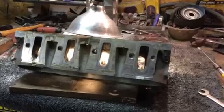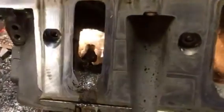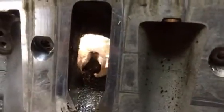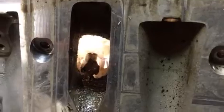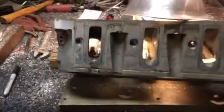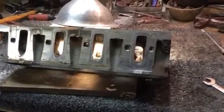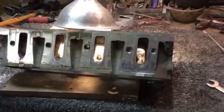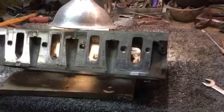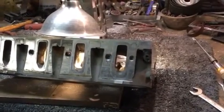But air doesn't turn corners - it doesn't like to, it doesn't do it. So when you port these cylinder heads, keep that in mind. Look at the back of this far left port - look at how dirty that is. The swirl ramp is removed and I've done some work on that guide, but look at how bad that line of sight is with that huge bump in there. You just have to use line of sight understanding - this is air, it wants to come into this head and get to where it's going without a bunch of turning or bouncing. Air moves in a straight line; try not to waste time digging and working in areas that the air is not going to touch.